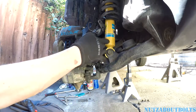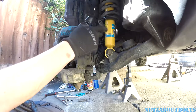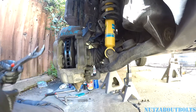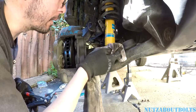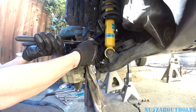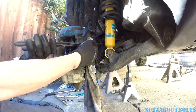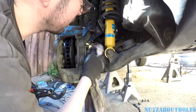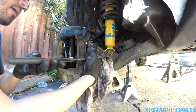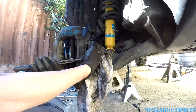One thing you'll notice — the mounting point for the brake line, the hard line, is in the same spot as the original one. So you don't have to change brake lines. I've seen they sell a kit online with new brake lines and I thought, oh no, what lines do I need? But when I looked at this stuff side by side, I realized it all mounts the same. You don't need that — as long as your lines are in good condition, you can just reuse them.